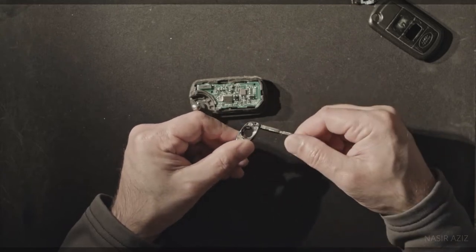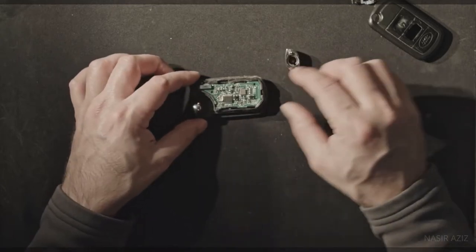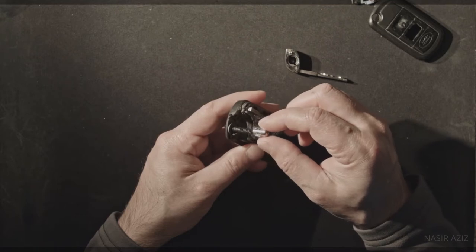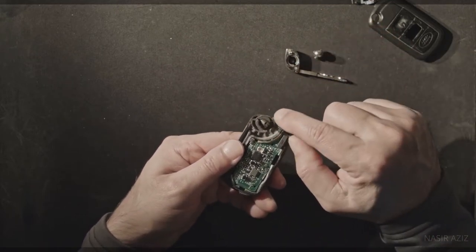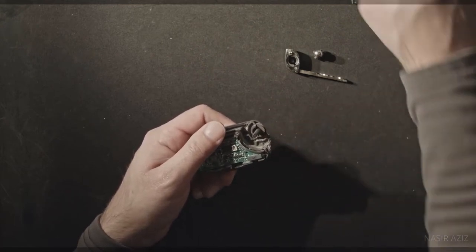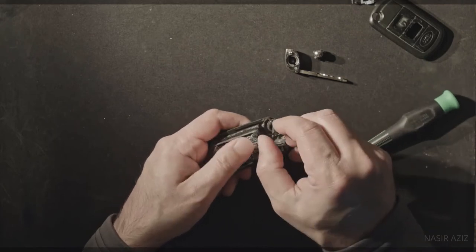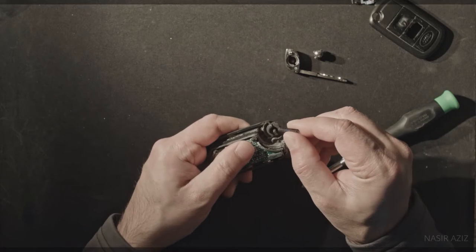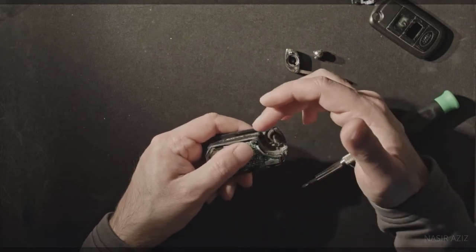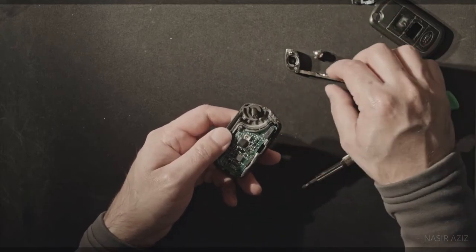I'm going to poke a hole — well, the hole's already there — push the pin out, remove the key blade, and insert it into the new one. Once you disassemble this you'll see the key blade. You can just pull it out. Notice there's a little notch — keep that in mind because once you replace this, the spring has a little thing that goes into the notch. When you put the key back, you give it a couple of turns to tighten the spring and then lock it, because once you push the button it just springs out.